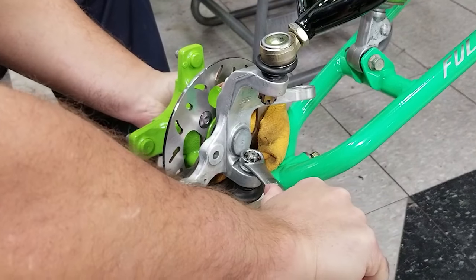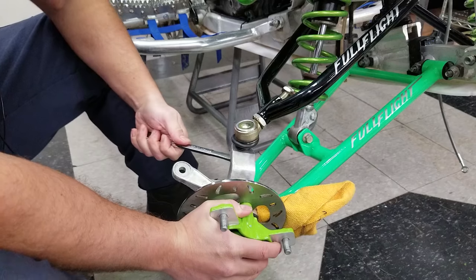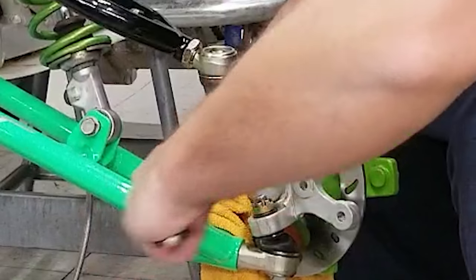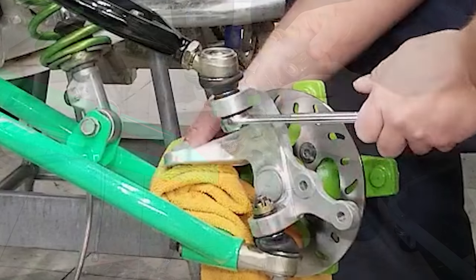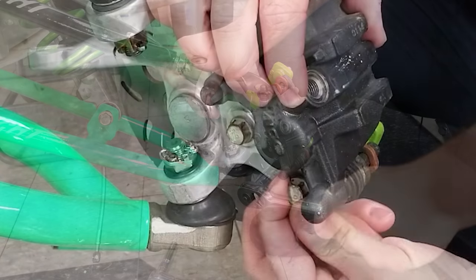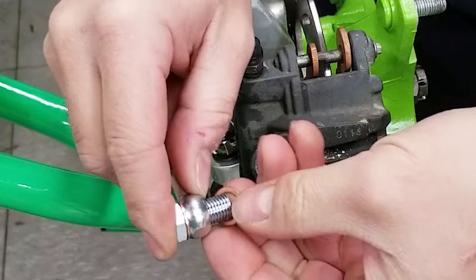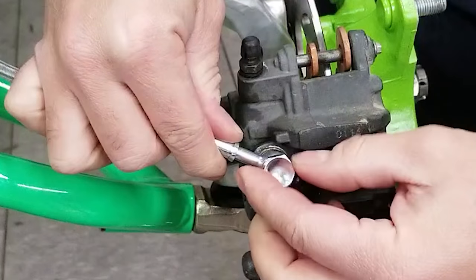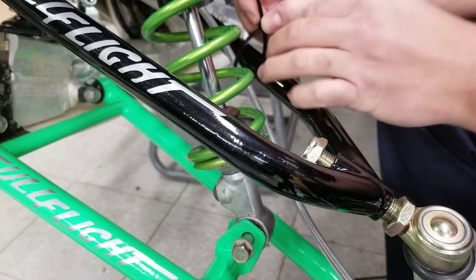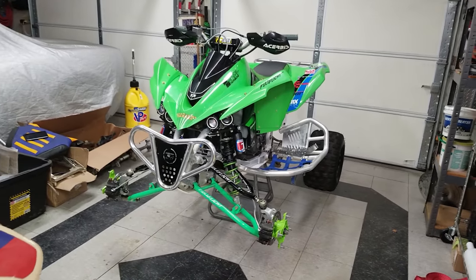I'm going to snug them by hand and get that cotter pin in there. When tightening up your spindles, it's a little bit easier if you have your tie rods in place to help keep the hub from spinning. However, I'm still waiting for my second set of tie rods to come in the mail. I'll get the brake calipers in place - don't forget to use a little bit of Loctite. Wherever you fasten your brake lines, make sure you can turn your hub through a full range of motion and the line isn't getting tugged anywhere.